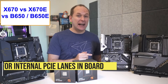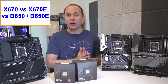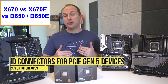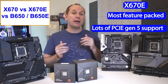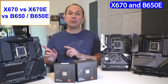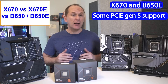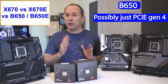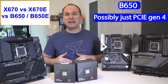That includes both the internal PCIe lanes in the motherboard itself, which allow for more devices to be connected even if they're at lower PCIe Gen 4 or below speeds, and also connecting devices specifically running at PCIe Gen 5 like SSDs and future graphics cards. X670E is the most feature-packed motherboard chipset, supporting PCIe Gen 5 devices at the main GPU slot and one or more M.2 slots simultaneously. X670 non-E as well as B650E chipset motherboards support either a PCIe Gen 5 GPU slot or PCIe Gen 5 M.2 slot, but not both at the same time. B650 non-E chipsets can offer PCIe Gen 5 lanes, but it's up to the board manufacturer and most are likely going to be PCIe Gen 4.